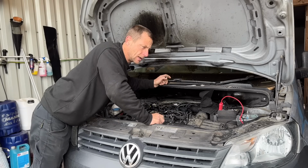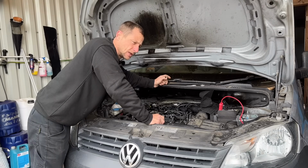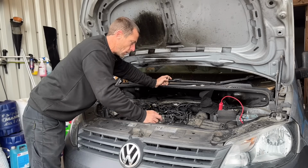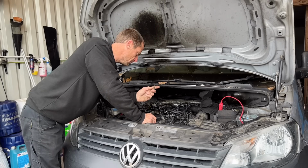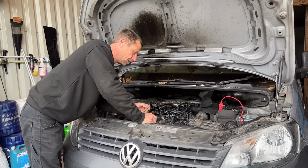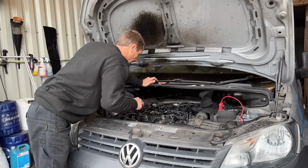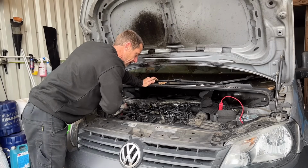And I do joke around in previous videos. Everyone says you've got to replace this bolt, replace that bolt. Well, I just stick them back in. With these, you do not want to reuse these. This bolt is probably a fiver, £6 max. Now, because they've been reused, or even never been apart, even though this one has had more injectors than Trigger's broom handle, they've probably been reused. So for the sake of £5-6 a bolt, there's only two, you won't be then paying out or wasting hours of your life stripping all this down and hopefully getting a snapped bolt out of the cylinder head just to replace them. Anyway, going to roll a time lapse, get all this stuff out the way.